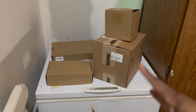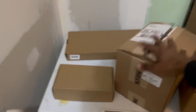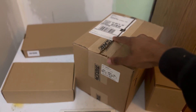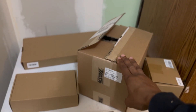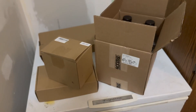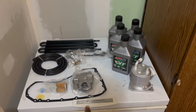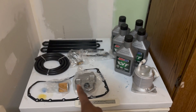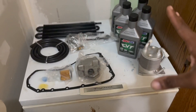All my parts have arrived. I have my oil pan so I know exactly how much fluid is coming out - they say you should be able to get five quarts out. I'm going to be using Amsoil instead of the Nissan genuine oil because from my research this oil is a premium style oil and it works better with CVTs. When you drain it you should only be able to drain five quarts at a time. Here are all the parts: the oil, the beehive assembly, gasket, filter, the cooler, and hoses - everything we should need to do this entire job.